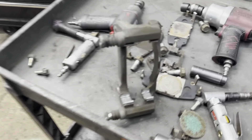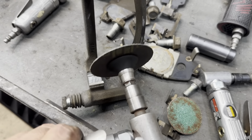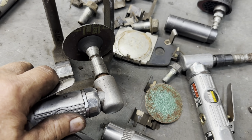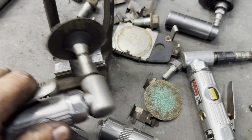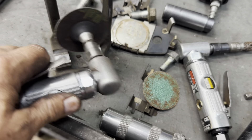Also I forgot to show you how I clean up my caliper brackets. I use my die grinder, get in there like that, and hit it lightly at an angle — just use it to scratch the surface.